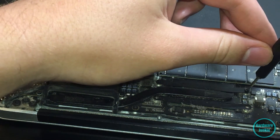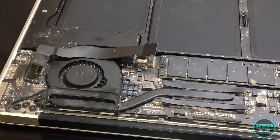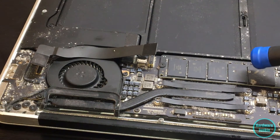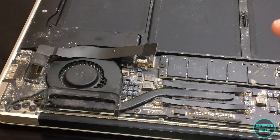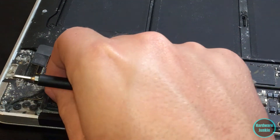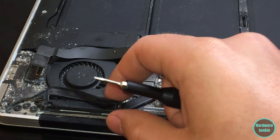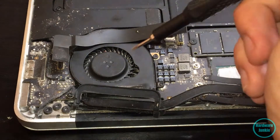This is the first time I've ever worked on a Mac before so it's a bit of a new experience. Every computer is basically the same though. This model is a 2013 - kind of the last time Macs were like regular computers. It has a regular SSD that can be slotted in. They did solder on the RAM for this one so you can't upgrade that. In order to get this piece off you have to almost peel off this adhesive right here - yeah it's like glued on.